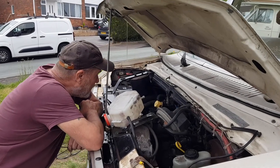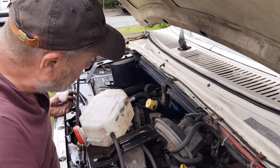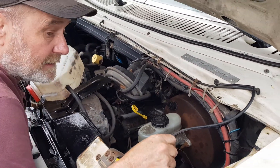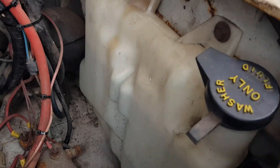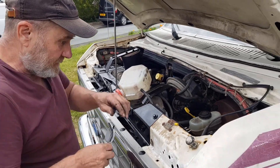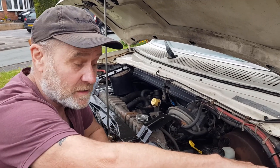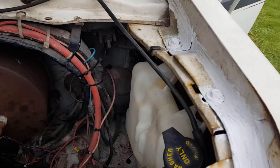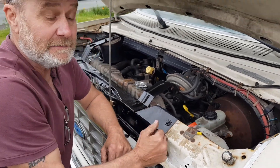Right, let's show the viewers our finished work — left hand indicator and now right hand indicator. Happy days, nearly there for the MOT. We've just put the wipers on — nice easy job, new wipers. The washers were working and then decided to give up the ghost and it looks like the motor's gone on the washer bottle. We'll have to replace that motor. We've got a good connection and good circuit through but the motor's not working at all — 12 volts to the motor. We looked at the motor, tested it out and the motor was actually working, so it must have been a bad electrical contact. Cleaned them all up, put it all back together — and now that's working.